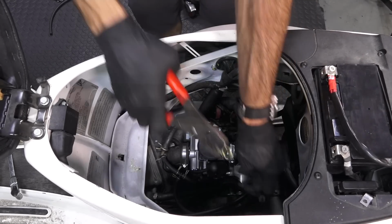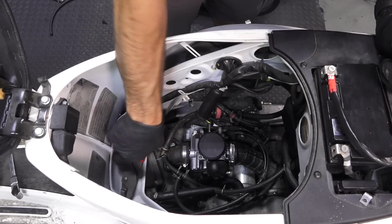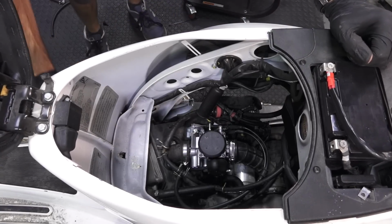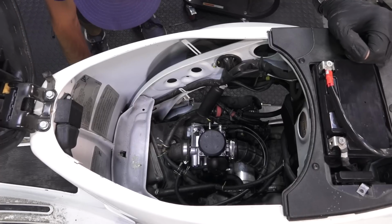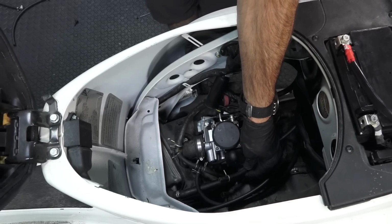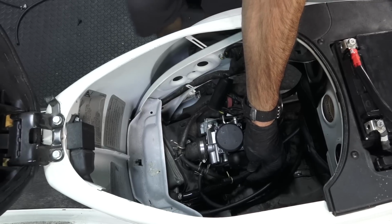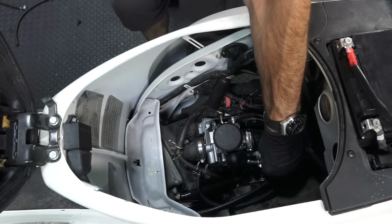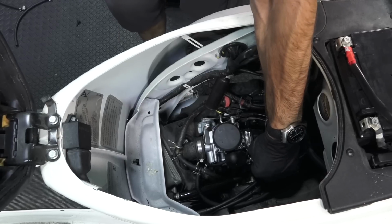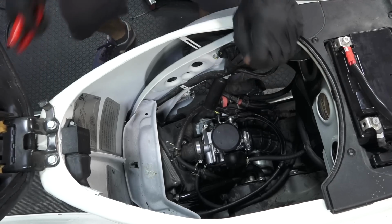And we'll put a clip onto the fuel line. Next, we're going to go ahead and fill up the fuel tank, and I'll see if the scooter will purge the first little bit of fuel through the fuel line before I connect it to the carburetor. So we'll just do a quick little crank and see it just pumped a little fuel. And we know that the fuel tap is flowing, and I just want to get any debris that may be in the fuel line out before it goes into this fresh carburetor. Go ahead and put the line on there, and we'll get the scooter started.